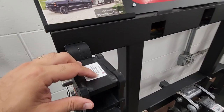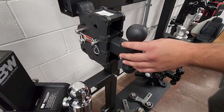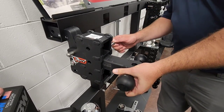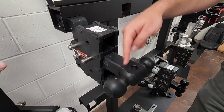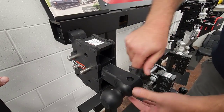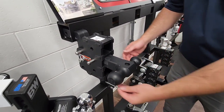Even this newer version, rated at about 12,000 pounds — which is actually a relatively low rating for a Gen Y hitch — is still super heavy for its size. They also give you a pull point for a shackle. Many people think that third hole is for a ball you don't have — which in this case would be a two-inch ball, since you already have two and five-sixteenths and one and seven-eighths — but it's actually for a shackle for a pull point. You thread a shackle into place and you've got a nice strong pull point. It's a closed system too, so there's less chance of something falling off and shooting back.